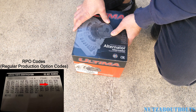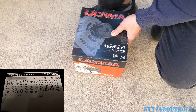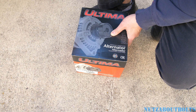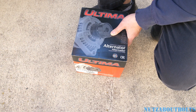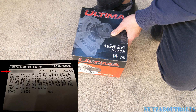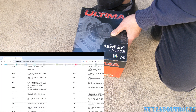Usually it's in the K category. In the glove compartment it's alphabetically ordered from left to right and then top to bottom. So you go from left to right and then all the way down until you see the K letter, and you're going to see either KG3 which is 145 amp. Others would be something else with the K. I'll make a list of the alternator size and amperage for you on the screen. If you don't know yours and it doesn't show up on there, look up your VIN code and go to this website — I'm going to put the link in the description below. You put in your VIN and then scroll all the way down to where K is and it'll show you your amperage.